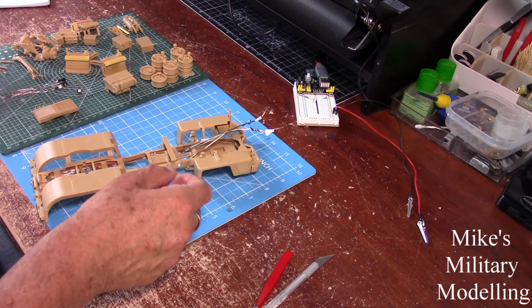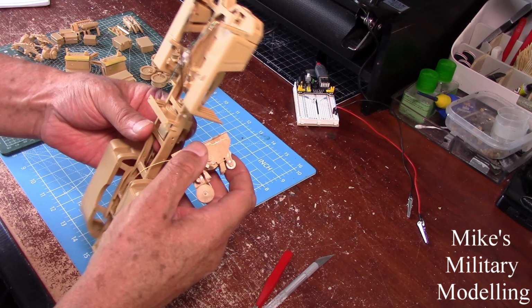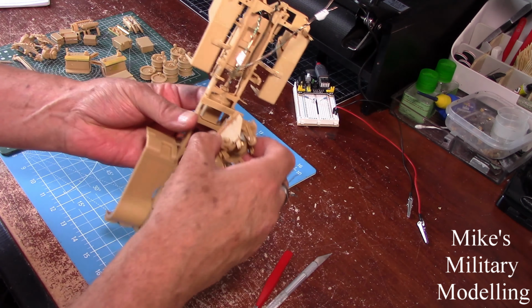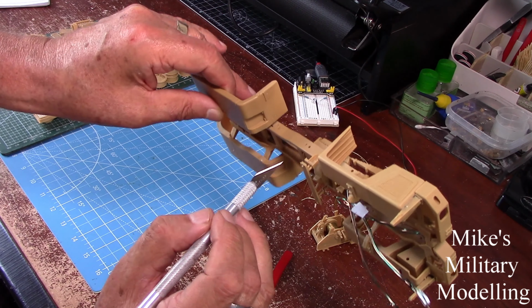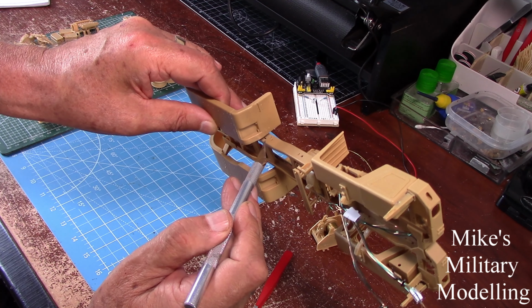then this winch, keep coming back to this winch, goes in and it goes behind those two mud wings there. So basically what you've got to do is prise them out just a little bit so that the two lugs on the inside of this winch will pop into the locating holes. I don't know if you can see, yeah, you can just about see one there. Yeah, they're into those locating holes.